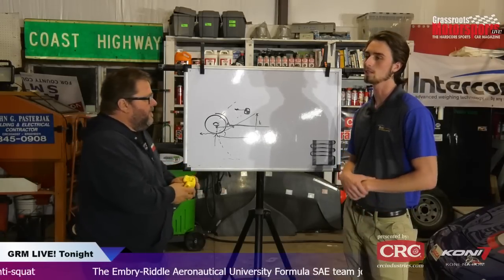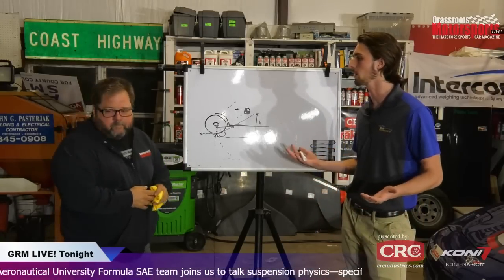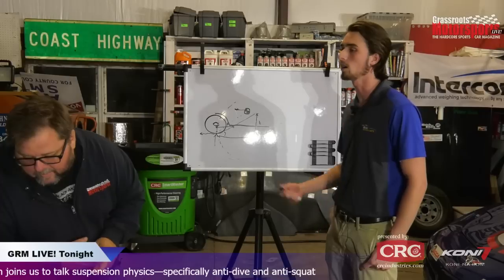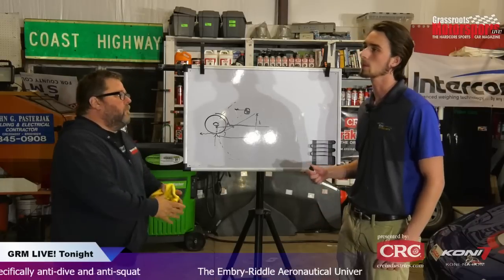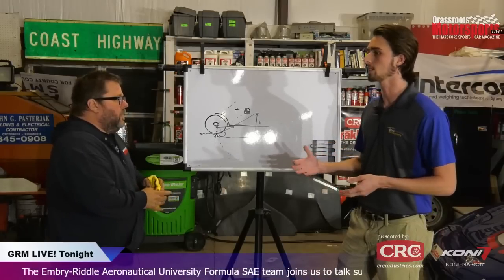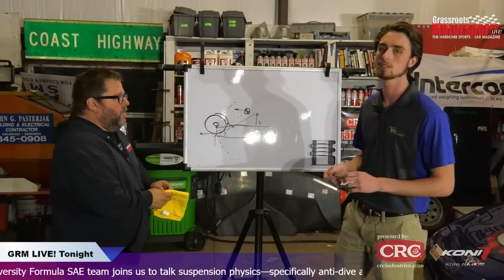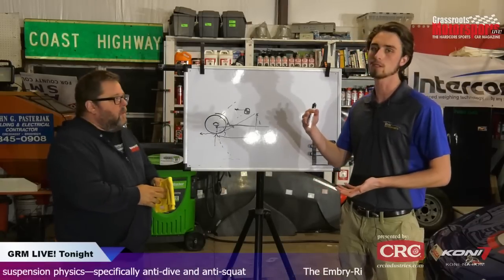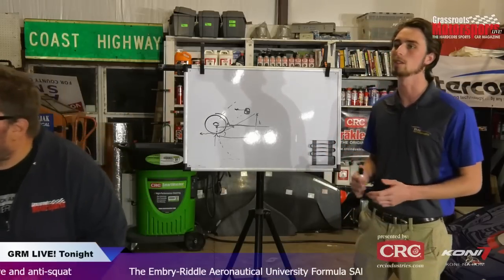So really, it depends what you're trying to achieve. If you were a drag car, you don't really care about anything other than going as fast as possible, getting as much traction on your rear tires, so you would probably want 100%, maybe more. In our case with our car, that becomes a little more difficult because it becomes hard for the driver to handle. If they step on the gas and the second they do, they have 100% load transfer on the rear tires, that's going to become very unpredictable to drive, because you're going to lose a ton of load off your steering. You lose that load off the front tires and take it to the rear. So essentially it's all a tuning thing, and it is down to the driver too.